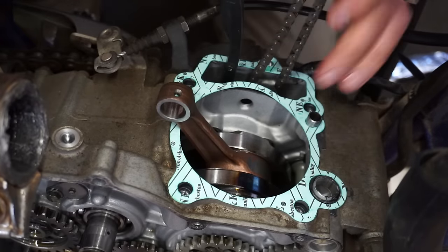This one's pretty brittle. All right, we got the carburetor pretty clean. It's nice and clean on there. And the bowl sat in the ultrasonic cleaner for, I think it was 30 minutes. Everything is clear there. All these ports are clean. This was completely clogged. That goes into the side of the carb. All these jets are clean and good to go. So let's install the new kit, the new accelerator pump kit.